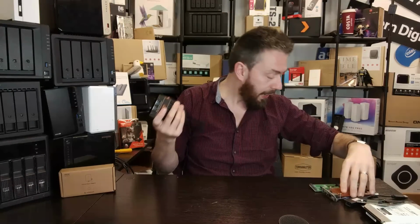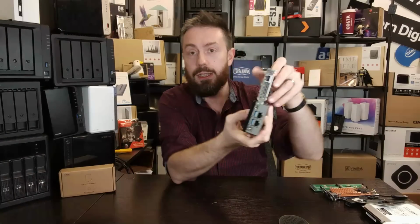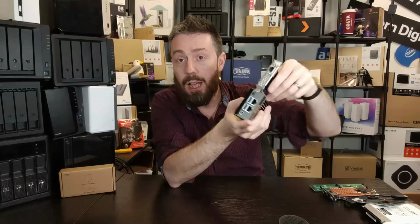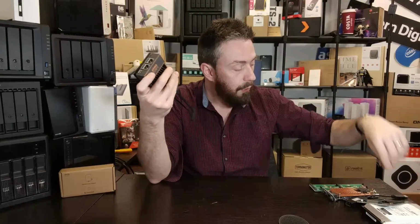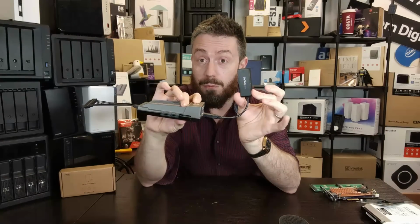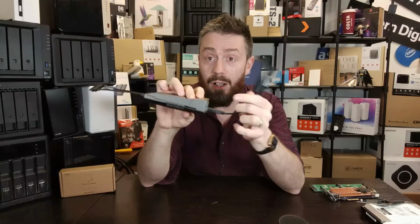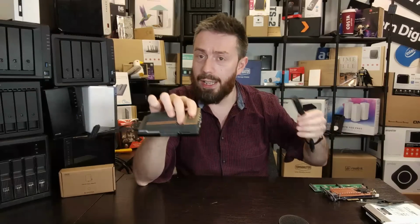But there are so many different kinds of adapter, whether you're going to go ahead with just a 10 GBE on its own, slam in 10G, you've now got your 2 1s and you've got a 10 GBE adapter there on top. There's a lot you can do, but then we haven't even factored in what you're going to do with those USBs. So for example, if you wanted to, slam in a USB to 2.5 GBE adapter, and you're cooking. Now you've got 2.5G and you've still got those little ones there. And there's even from StarTech that USB to 2 RJ45 card as well. So you don't even need to utilize the PCIe and get rid of it just to add more LAN ports.